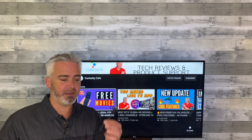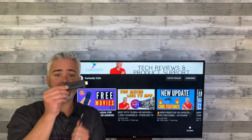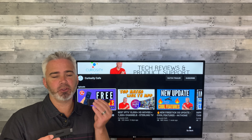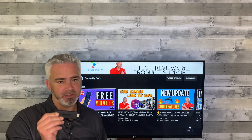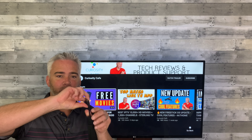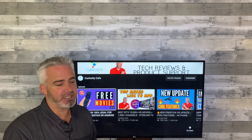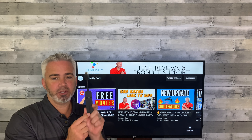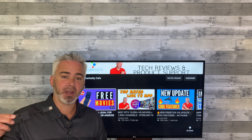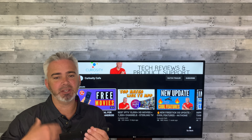That's the reason why they came up with this — the extension cable that comes in the box. You may have opened your package, saw this, and thought that's all you need. Well, they added this for those that don't have HDMI on the sides of their TV and only have it in the back. What you need to do is plug that extension in so that when you plug it into the back of your TV, it is not directly against your TV. That will cause heating — it's actually the TV projecting heat onto your Fire Stick. What I do is use the side HDMI and the extension, doubling it up so it's further from the TV and runs cooler.